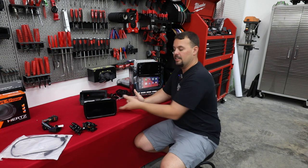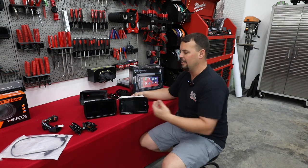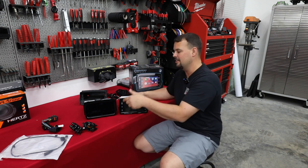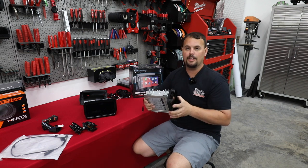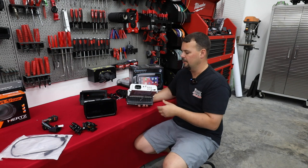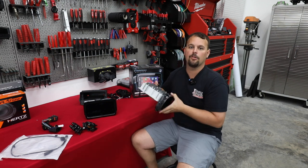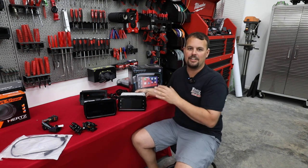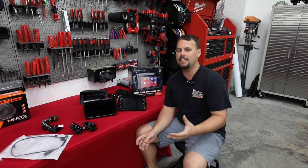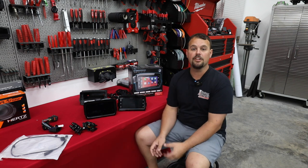This last year, in January, was released the Soundstream Reserve HDHU14. As you see, it looks like a GTS radio. It's built to the exact size, shape, mounts the same way, uses all the factory harnessing, but it gives us some additional features. It gives us RCA outputs. It gives us Apple CarPlay and Android Auto built in. No need to flash this radio if we're gonna do an amp upgrade. Also gives us a 13-band EQ with adjustable high pass and low pass filters. All that means it's gonna sound great.